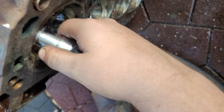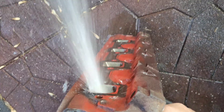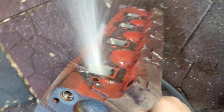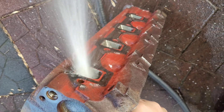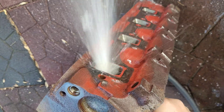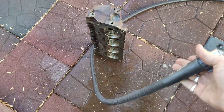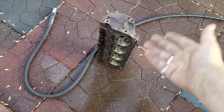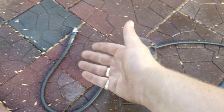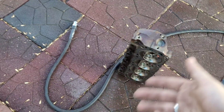Now the exhaust flow comes this way. In the exhaust — you notice anything? Where is all the water going? It's sticking right to the roof. We didn't touch the bottom at all, because frankly it'd be pointless. But we did raise and widen the roof — because that's where all the airflow is going, right up here. Very easily, you can test exactly if anything that you did made a difference, very arbitrarily of course, but it gives you the results.